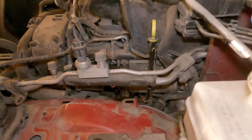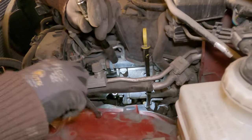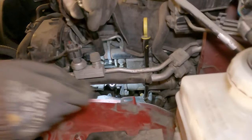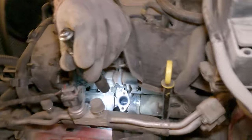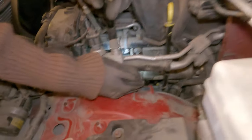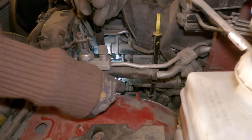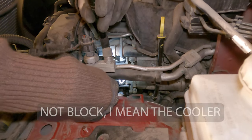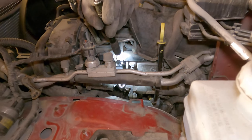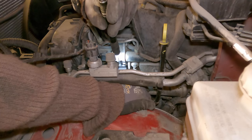So the reason why we need to remove the cooler is to get to this bolt here, the one bolt behind there, which is connecting the cooler to the EGR valve. So also see the blank in between the EGR and the block. So you just put a plate in between there, then the mechanism in the EGR valve doesn't get sooted up. It's on and still works, but...